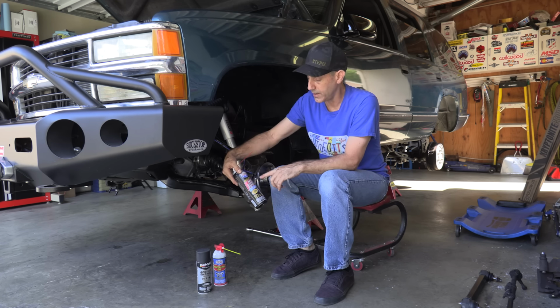Finally in the front, all I did was I went and bought one of those cheap Amazon 2-inch lift kits. So I put in new lift keys, and I should explain, I have a black eye, or I'm healing from a black eye, because while I was putting those keys in, one fell out and hit me in the cheek, and I'm still healing up from my little black eye. They're heavy, those little suckers. So in the front, I got some torsion keys. We're just gonna do a little tweak. I think it was $180 maybe for the two keys for the torsion bars and then 2-inch blocks for the rear.